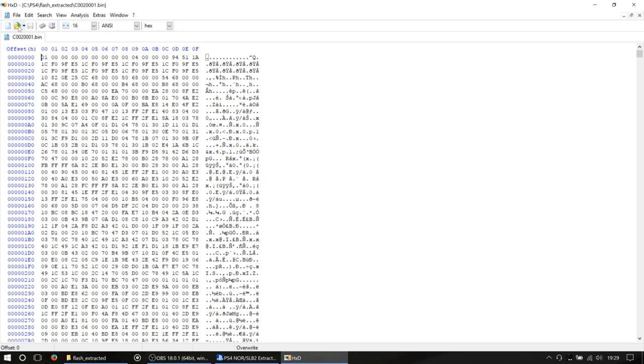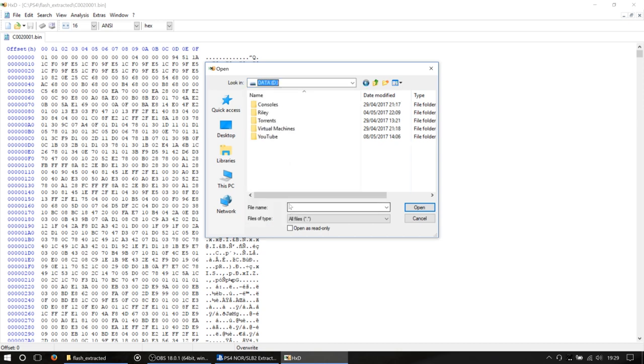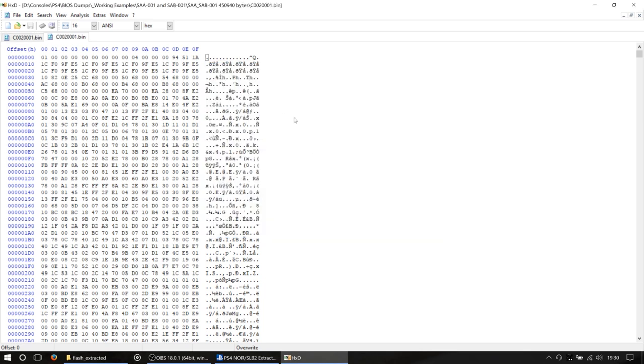Okay, and then we're going to go and open our template. So our one we know that works and works well. PS4, BIOS dumps, working examples. Remember ours was a 450,940 byte file. I'm going to say OK, and we're going to open those. OK, so we have our known working one there selected. Open here in this tab is the one that we've just repaired.